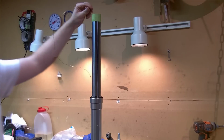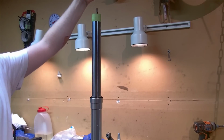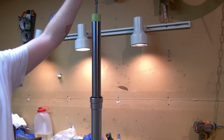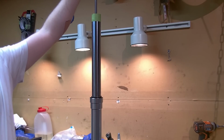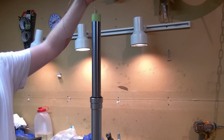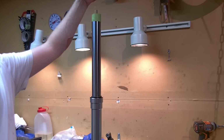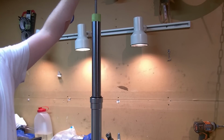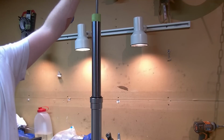Now using our wire, when we start our first bleed, we will use the damper rod, which is attached to our wire, and we pull up and down slowly 10 times. What we're doing is bleeding out any air in the system, and it may end up pumping oil up through the top. Be ready for that. Don't be startled if anything happens to squirt out. Just use our rod here.